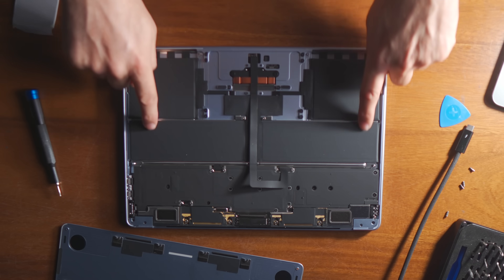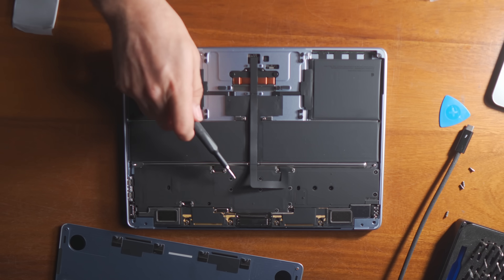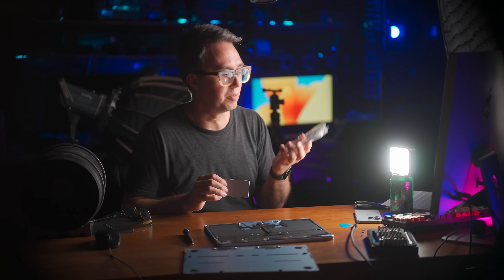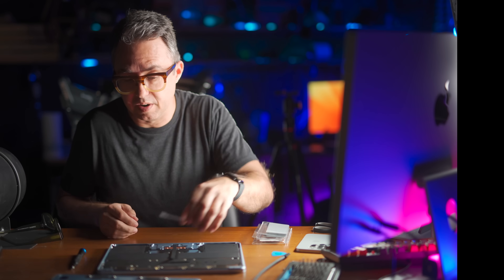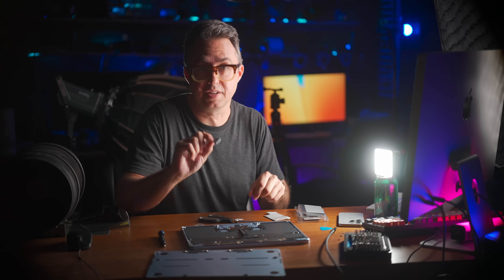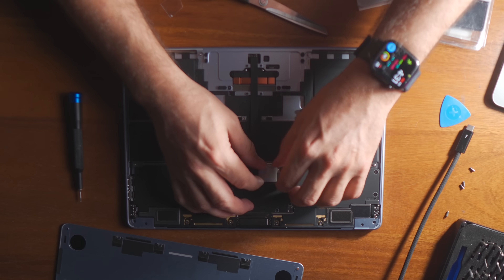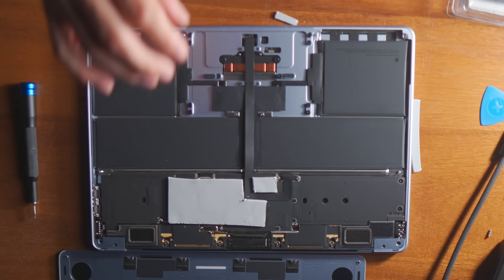This is the trackpad side of the computer; this is the hinge. Now inside here, most of what you can see is just battery. This little ribbon is what goes from the trackpad to the motherboard. Then this black rectangle across the top here is the whole motherboard, with the M4 situated somewhere around here in the middle — that's where it gets the hottest, and that's where I'm going to start with my thermal pads. Get one millimeter pads. I'm just going to stick these things across as much of the motherboard as I can cover. You can cut this stuff with scissors — no problem. Just make sure you peel the plastic off of both sides, otherwise it won't transfer the heat. This is not a definitive guide — this is a test.